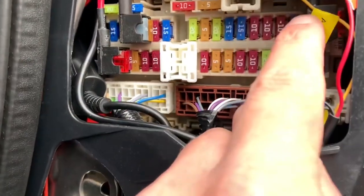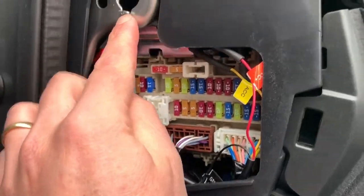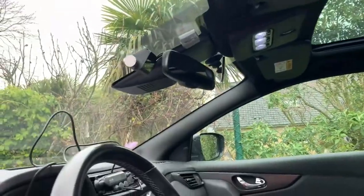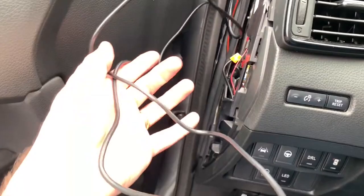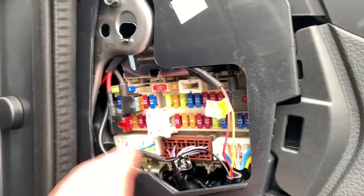Here's my continuous fuse, there's my accessory fuse. I hide the cables over here with a little bit of protection tape so it doesn't rub onto the metal part. There's my ground, and here I hide the little hardwire box — well tucked away so it doesn't rattle. Now I'm going to feed the cable behind this rubber seal. Here it goes — it follows the liner, and here you can just go down. I tuck the cable away; everything is still really accessible and nothing dangles around.